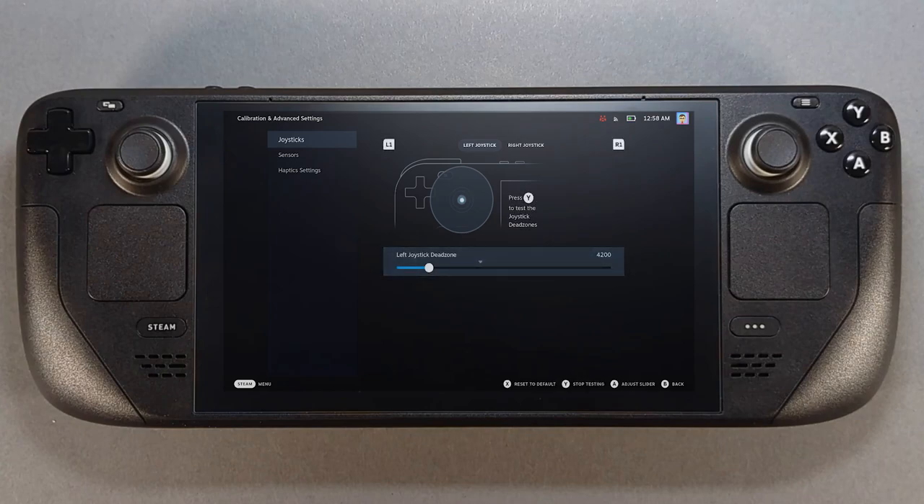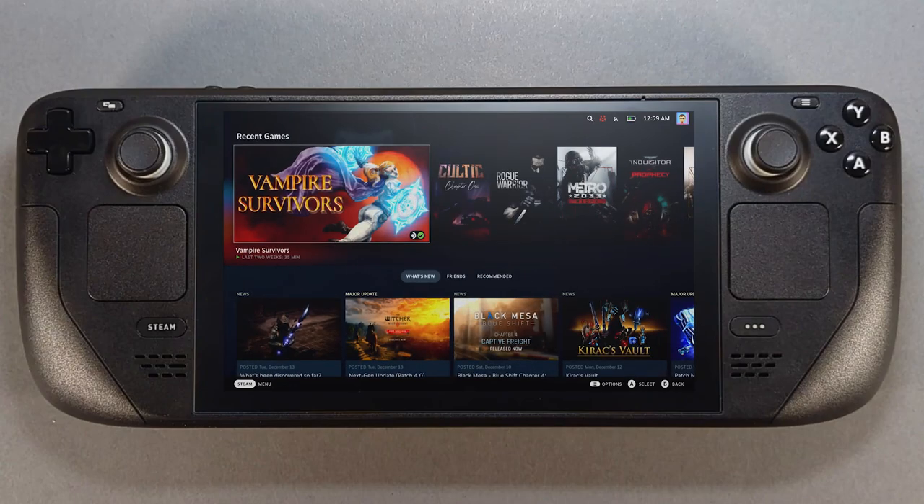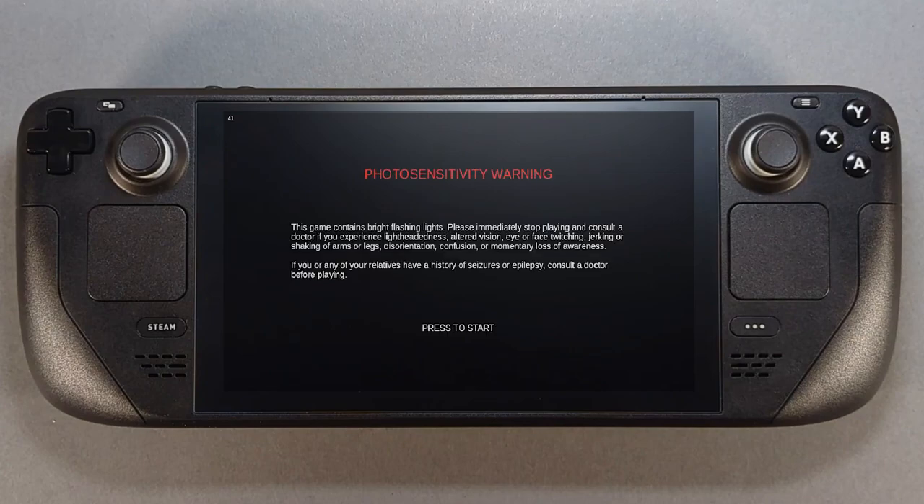Exit the console and on the desktop double-click to return to gaming mode. The joysticks will be corrected and resting in the middle of the calibration test area. Adjust the dead zones to your liking — if the dead zones are set to virtually none, you can accidentally cause undesired movement in-game. Like and subscribe if I helped you out — thanks for watching and I'll see you in the next video.